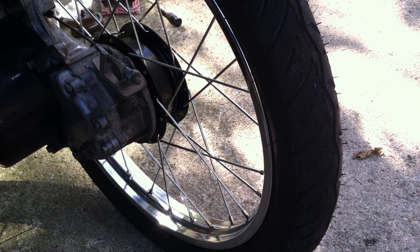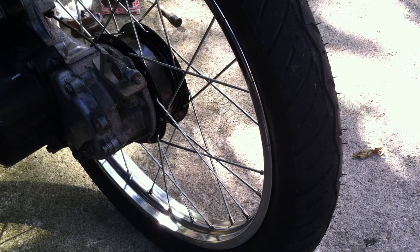What we did was we stuck on the kitted engine, we should have no problem at all turning this 16-inch rear wheel. And also got the Malossi final gear in there as well. So I'll have to switch to either the stock belt or the 9325 belt as well on this. But yeah, carburetor. Oh, I've got the Sudco adjustable main jet on that for that VM20, so that should make jetting a piece of cake.